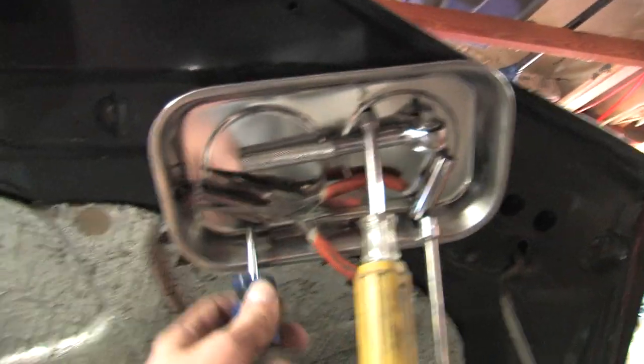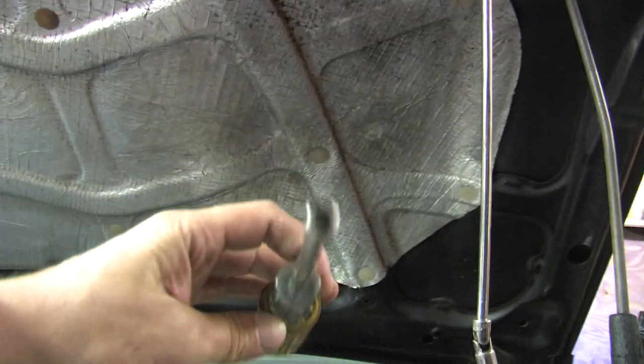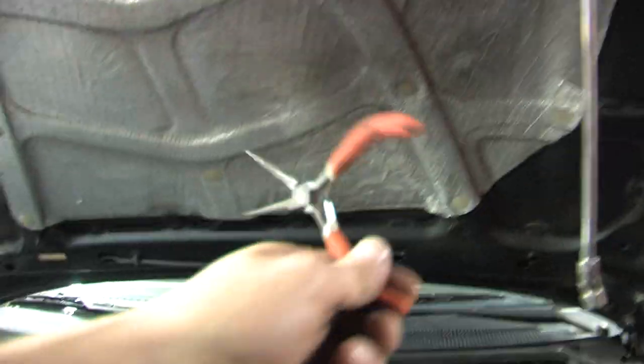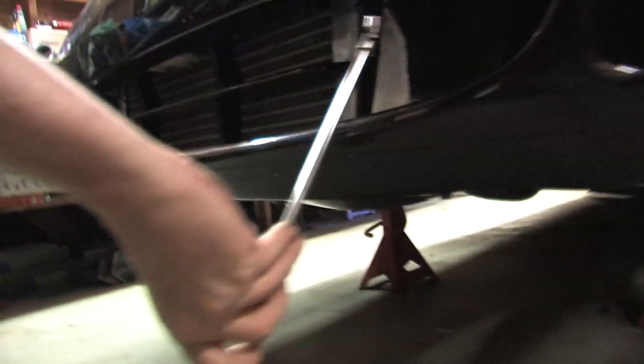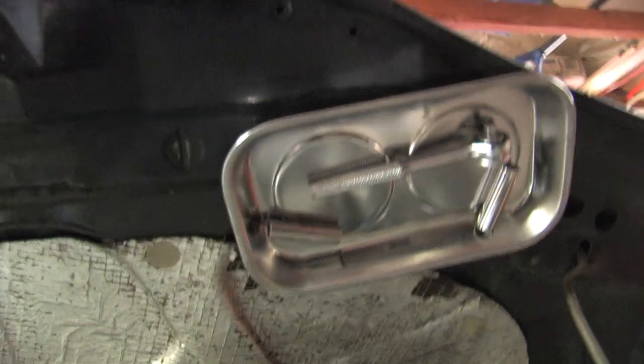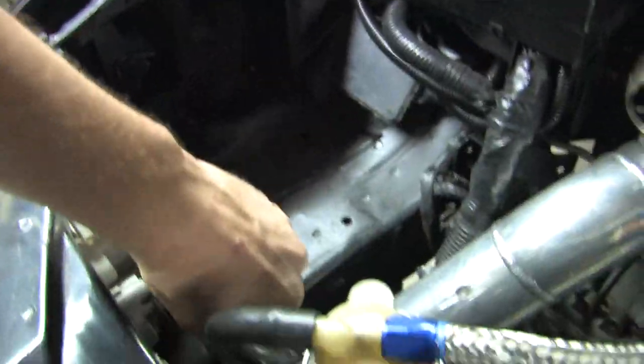So I'm going to go ahead and take this thing off. Here are the tools I use — get all your tools together and just get ready to rock and roll. Basically you need a Phillips head screwdriver; a stubby one helps if you have the wheels on the car. There's an 8mm or 5/16th inch nut driver — good for taking off the intake and stuff like that. This tool helps take out the plastic fasteners along with the Phillips head. And we've got the swivel extension: a 10mm swivel on the end of an extension so you can reach up inside of this hole and get to that fastener without too much difficulty. Of course, I don't need to do that anymore. I've also got an 11mm — which is the same as a 7/16ths — and I use that for all my hose clamps. And a standard 10mm just in case I need something that doesn't swivel.